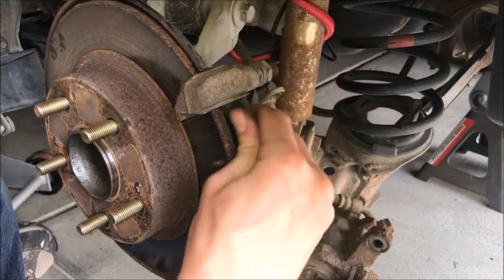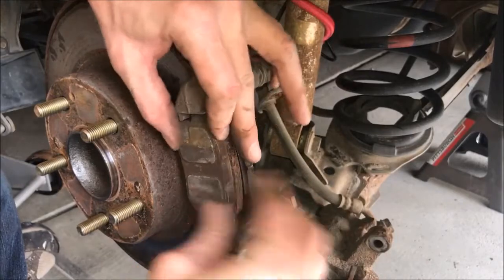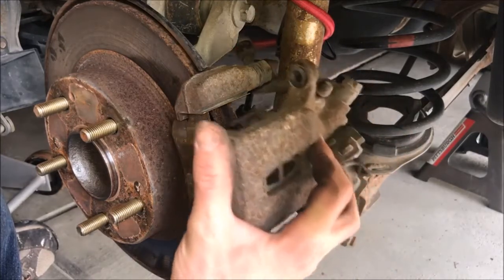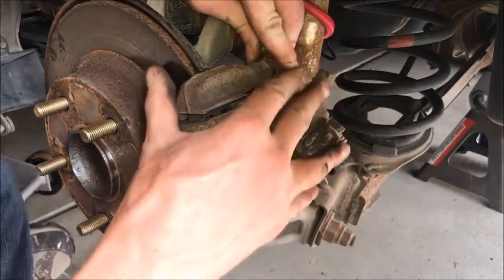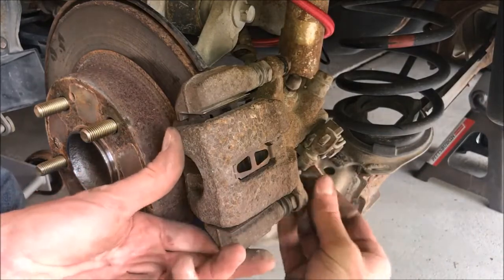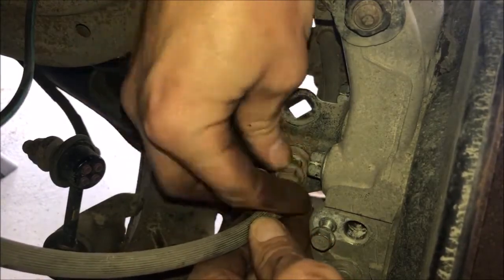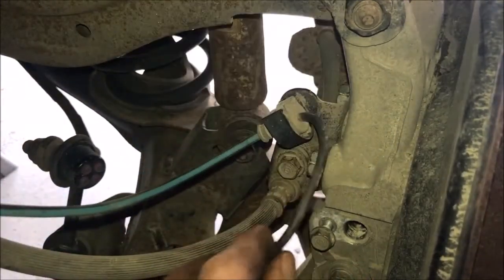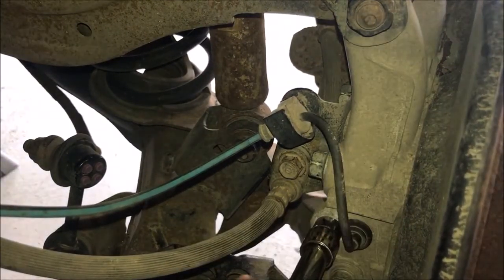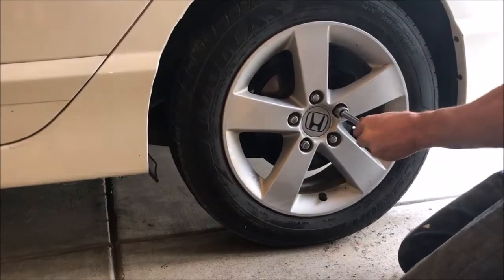Sometimes the brake pads go in a little tight — just keep at it and don't be afraid to push these in using good pressure. Now mount and install the brake caliper. It's a little tough to align the bolts sometimes, but just be patient and apply pressure to different areas to manipulate the caliper in the direction you want it to go. Now install the brake line mount. Now install the speed sensor and the sensor mount — I'm driving the bolt in to keep it in place and we'll replace it soon. A final step that's overlooked sometimes is to install your lug nuts at 88 foot-pounds in a star pattern.